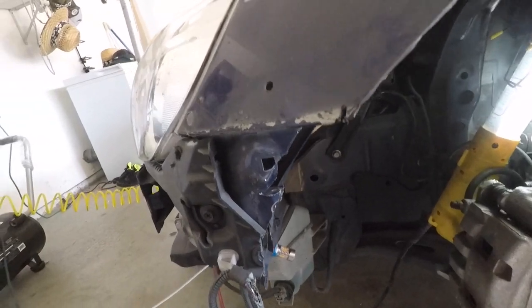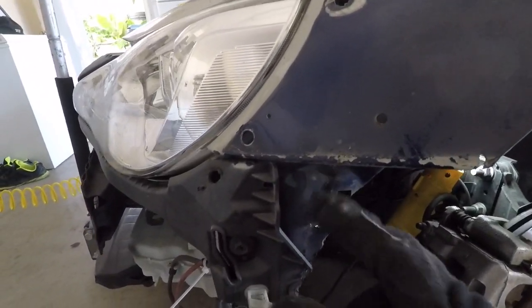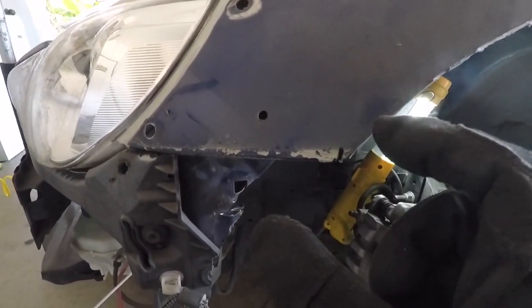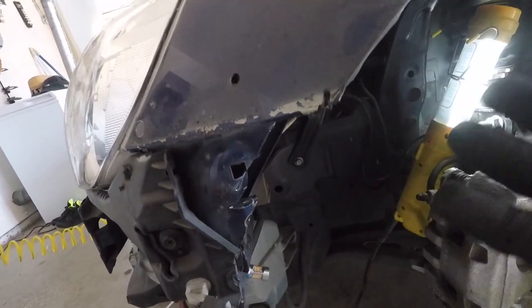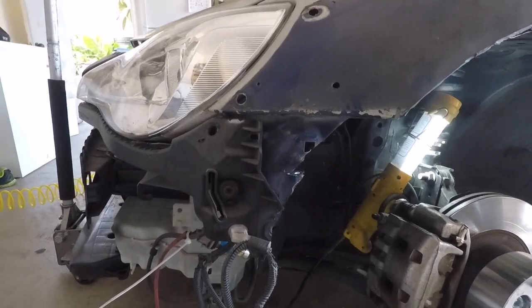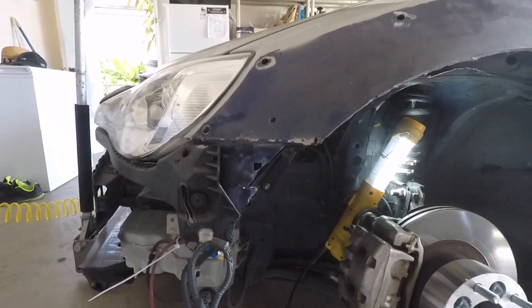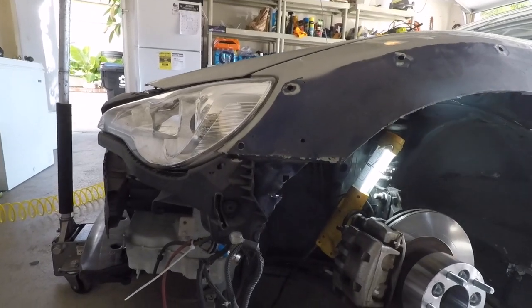I think I've trimmed enough on the front as well. I did the little cut slit things over here. I also removed the bumper bracket, which I don't really need because I have the quick releases that attach to the fender and the bumper — so that holds itself in place. You can hammer it or trim it. I've pretty much cut everything on this car already, so I just cut those slits and hammered it in. That's a lot of room that's been cleared. All that's left is to do the other side, then throw the wheel on and see if it clears.